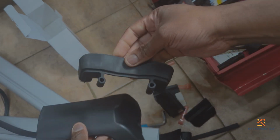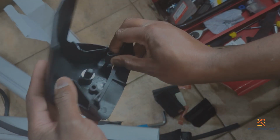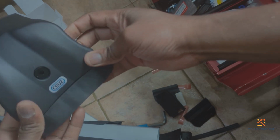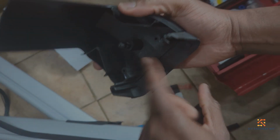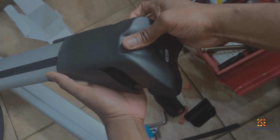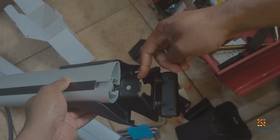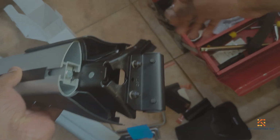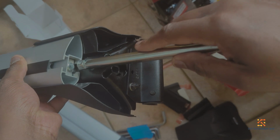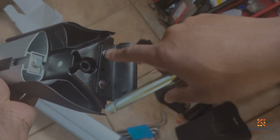But then this rubber gasket over here is going to be slotted there. Going to slot it there, so that, see that rubber gasket, so that when I close up the assembly, it's going to slide this, then I'll lock it up. But I'm going to mount these on the car just like that while it's loose. Then when I'm happy with my distance, I'm going to lock this nut up with this special tool. Ideally, you should be tightening these to 5 Newton meters.